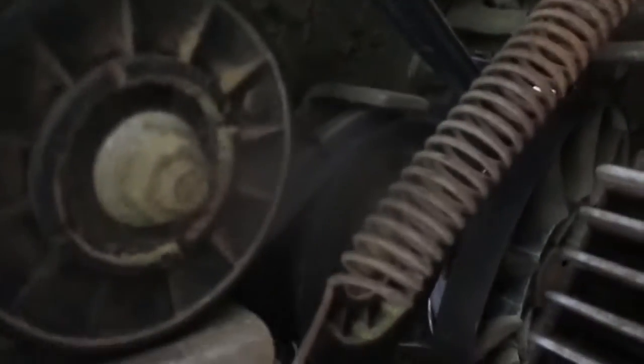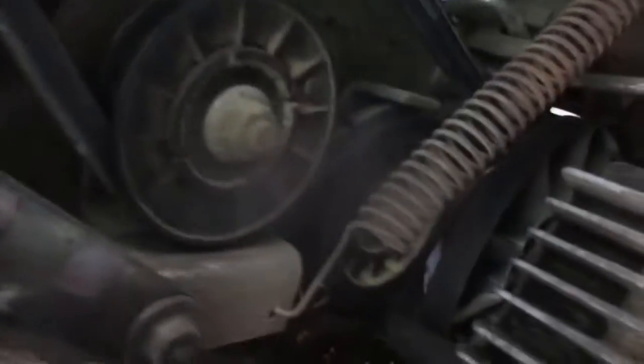In this case, those bolts are going to have to come out and the steering column is probably going to have to be lifted up a bit and pulled back, because the belt goes on both sides of it. There's the front pulley down there, the back pulleys at the rear, and there are the tensioner pulleys. This pulley will be right there.